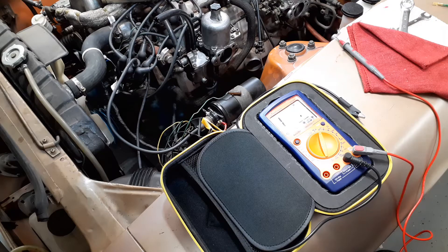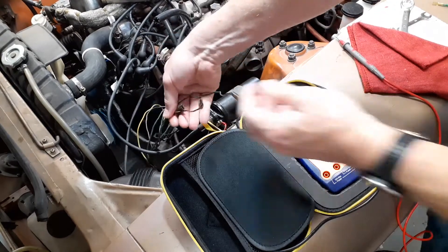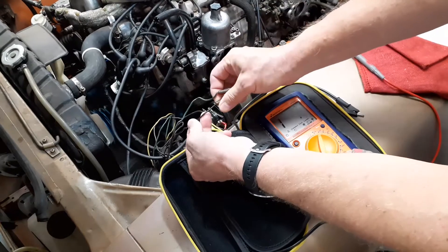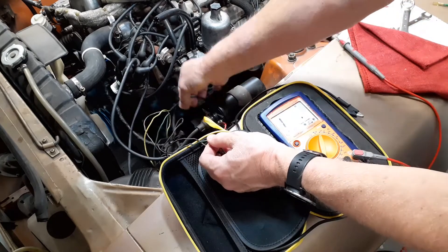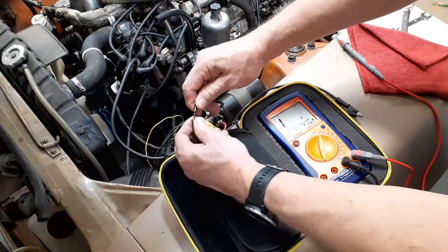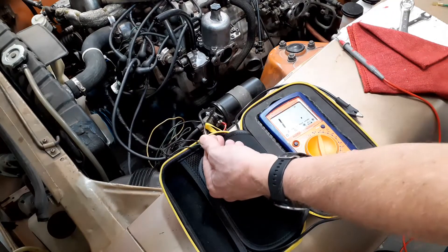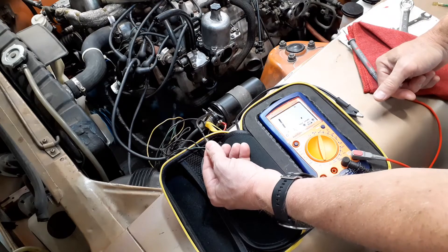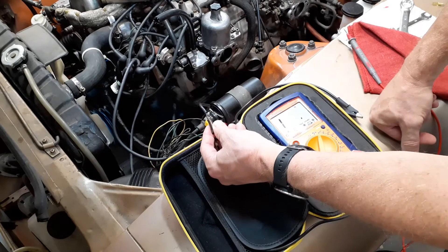The question came up about the proper wiring of the ignition coil on a 240Z. I removed the wires from the coil. There's a black with white stripe, a green with white stripe, and another wire that's also black with white stripe. So there are two black with white stripes — how do you tell which one goes to the coil and which one should go to the ballast resistor?